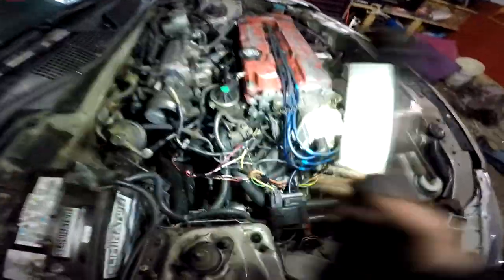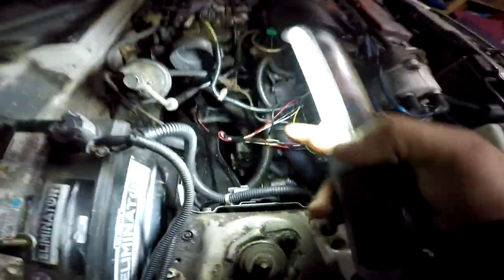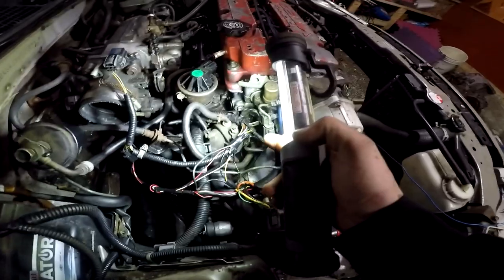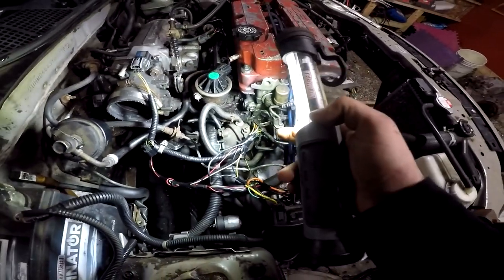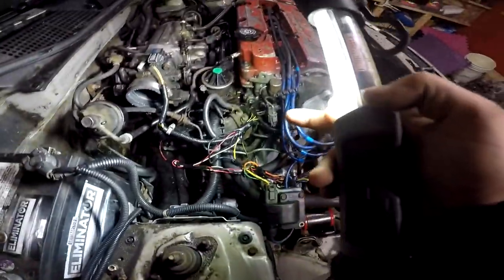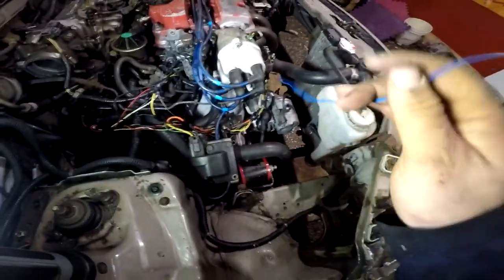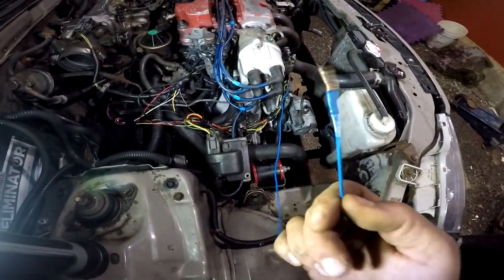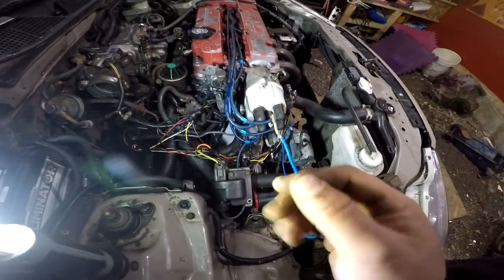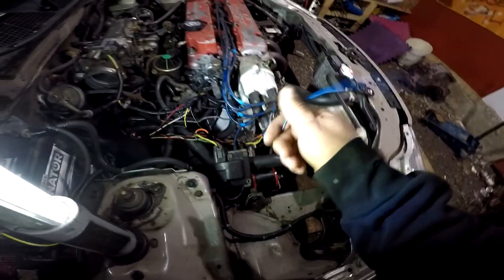All right, guys, so the wiring is kind of messy right here, but Nathan worked his magic. All these wires right here, you need four of them for your crank sensor. The four color match to your 8-pin distributor off your 2000 Y8, and the other four plugs are all color matched anyway. They're all plug and play, and then we got this blue wire left over. We don't know what that is. Some threads say it's tachometer, like the RPM wire, but some threads say it's your ignition or something. So we don't know if this is gonna go.